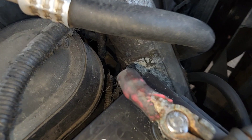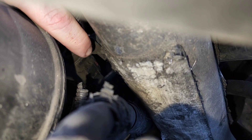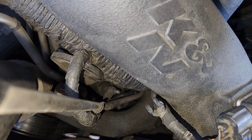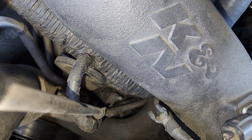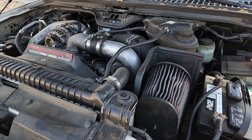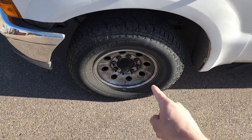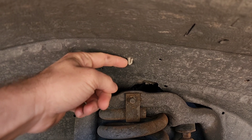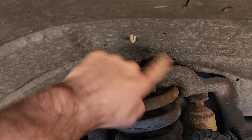I turned my light on because if we get our eyes right into the pit of abyss here, this plug is where the harness plugs in on the passenger side, and somewhere on this lead is where the driver's side plugs in. Here's the biggest problem with the glow plugs on this truck — you access them through here. I think we have to take our wheel well off, and there are a few wire connectors that poke through. I think if we take this cover off, we'll be able to see the glow plugs right in there.